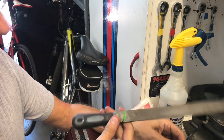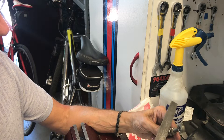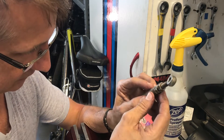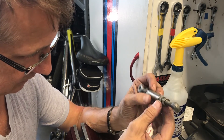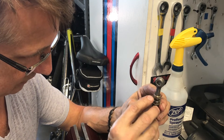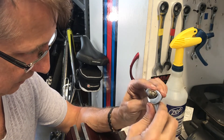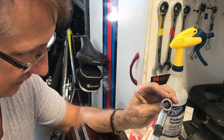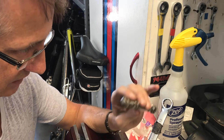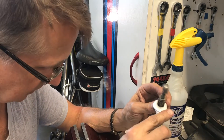One other thing I'd suggest: take a file and put it on the thin side and just give it a stroke wherever you see 30 years' worth of wrenching where the bolt is getting a little bit stripped. These are salvageable even though it's worn down a lot — these are 13s and it does still work. By the way, if you can get the top part on one of these things, it turns much better. Whenever I'm really trying to break something loose, I always use the box end rather than the open end.